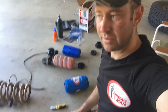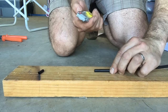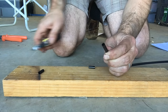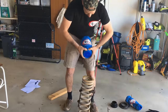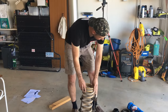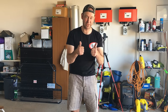So I'm up to connecting the tube to the airbag — this wasn't going to be an install video but it's kind of turning into one. When you cut this tubing, you've got to do it perfectly square with a sharp knife and a bit of wood — straight down. You don't want any blemishes on there whatsoever. These little suckers are great but they're so hard to get inside the coil — you have to squish it and push in and you risk ruining the sheath. Here's a simple trick: just squish it down with your knee and wrap some cable ties around it. Easy as that. I hope that saves you like an hour.